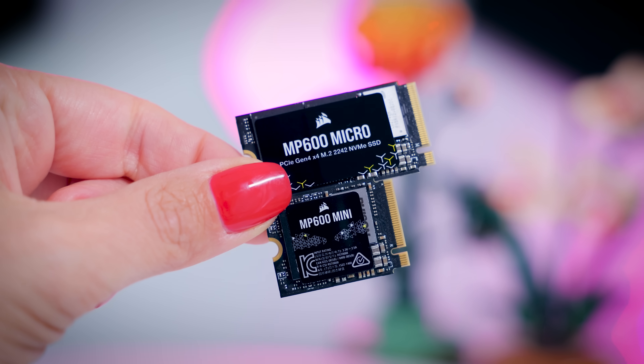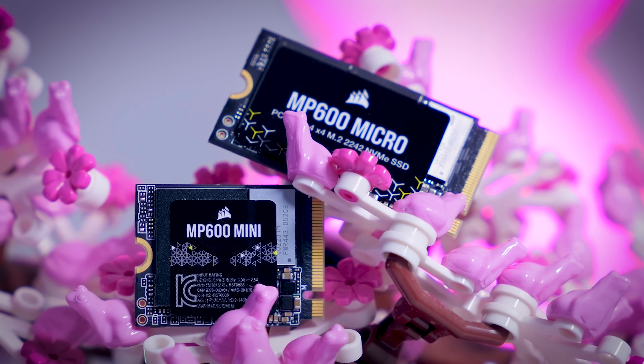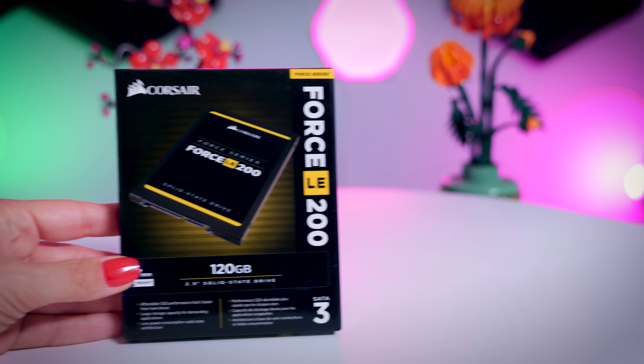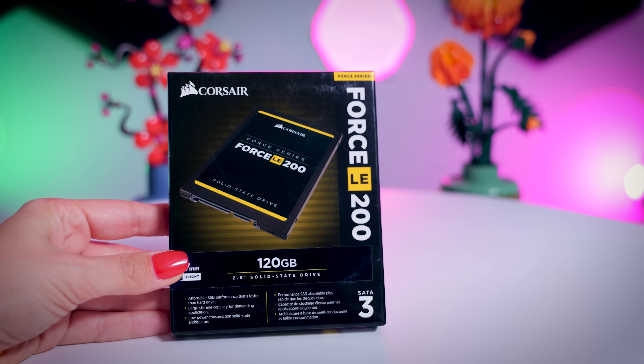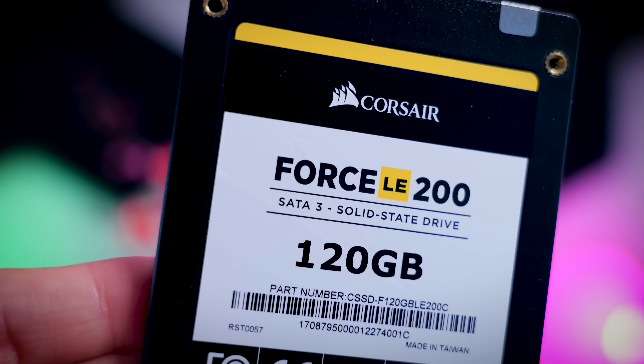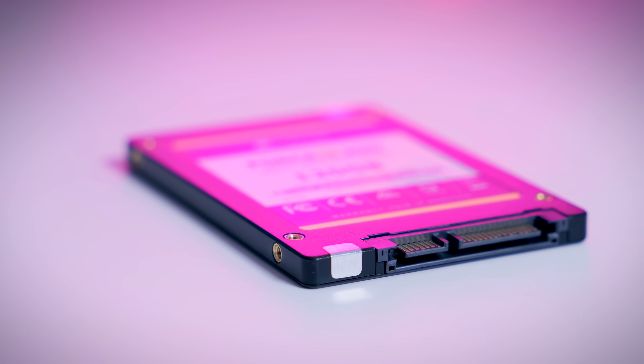If you're looking to upgrade a smaller device, like a gaming handheld, a mini PC, or some extremely thin laptops, you might have to look for a smaller SSD, like a 2230 or 2242. This just means it is 22 millimeters wide and 30 or 42 millimeters long. And if you're in a very old system, you might be limited to using 2.5 inch SATA SSDs, which were the main type of SSDs until several years ago. 2.5 inch SATA drives haven't had any development in recent years, and all your options will be very old by now.